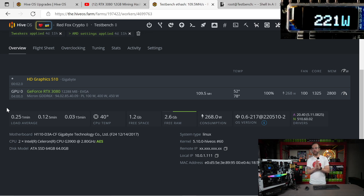The other thing you're probably noticing is it's saying 268 watts in the software, which is not accurate. If you're paying attention to the meter on screen, you can see it's jumping around quite a bit — as low as 220 watts then up to around 310 watts, and that's pretty much what I've been seeing. It stays a little more steady at the higher wattage, whereas previous LHR unlock iterations stayed more steady at the low and spiked high. This is bouncing around quite a bit, so take that into account if you're building a rig with these cards — the watts reported in software may not be accurate to what it's actually doing at the wall or in-line over PCIe.